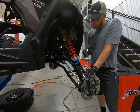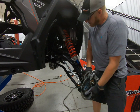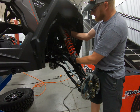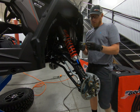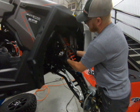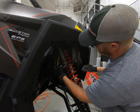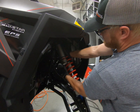I've already got my lower bolt loose. I'm going to leave it hooked up because these shocks have an internal spring, so it's nice to be able to extend it all the way to help back your preload off. One tool that's helpful for backing your preload off is a quarter-inch punch - you can put it in the holes in the preload nut. This one happens to be loose enough that I'm just going to turn it by hand, but if you can't, put a quarter-inch punch in there and twist it. This car is a little harder to get to than some others.